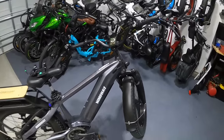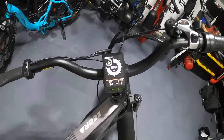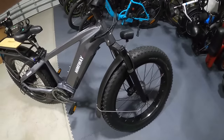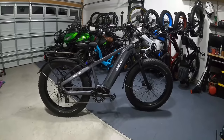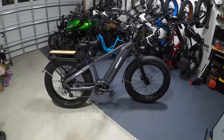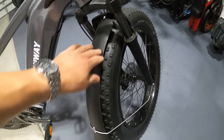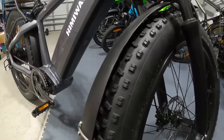For me, this upgrade is worth $133 - I like the extra speed, it was a great top speed increase, and I now have a color display that's much easier to program. I've done a lot of changes to this bike. These giant 4.9 inch Tsunami tires are one great thing about the Himiway Zebra - it allows for them and it just looks so killer. It's a great platform to build your ultimate e-bike. To fit these tires, I had to customize the fenders - I cut off the little lip that hangs down on the edge to get proper clearance.